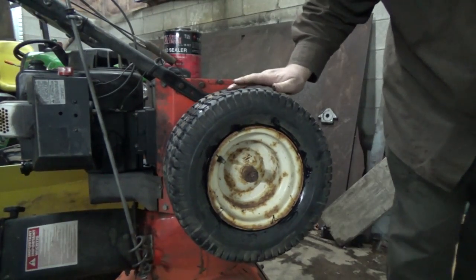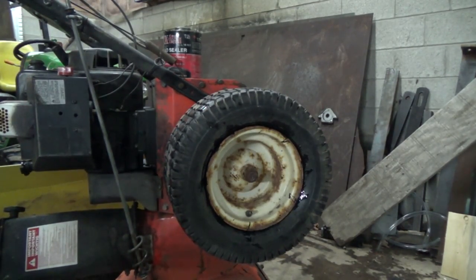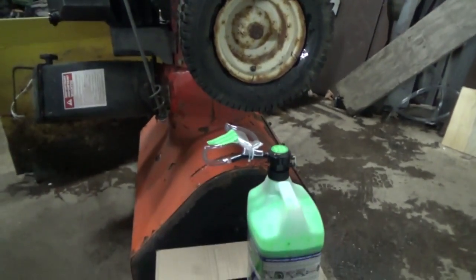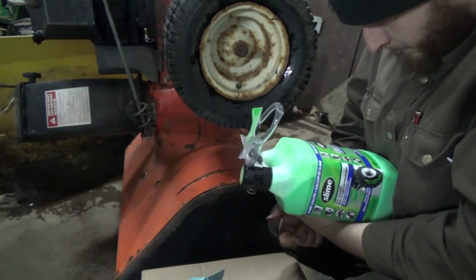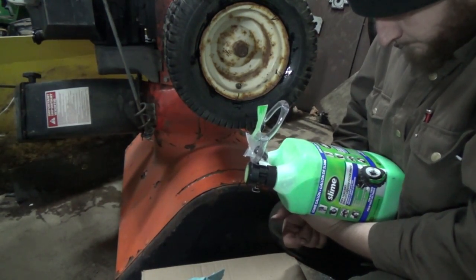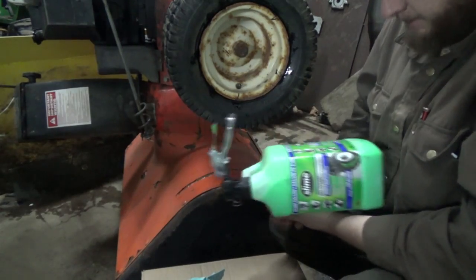Okay. So while we got her, grab a little towel here. We'll get the green goo here. And now this is 30 mils per pump, so 30 mil. And for a wheelbarrow tire, they say 237. For an ATV is 710 to 946. Truck is 590. Ooh, the ATV takes a lot more. Or trailer tire is 355 mil.